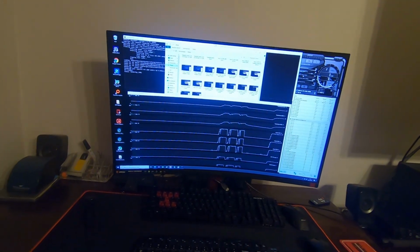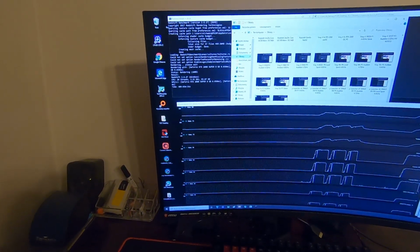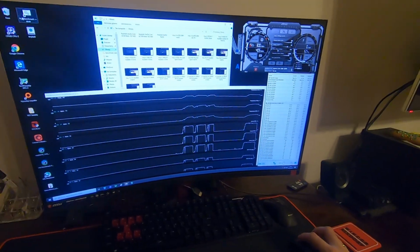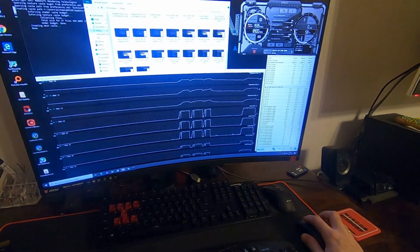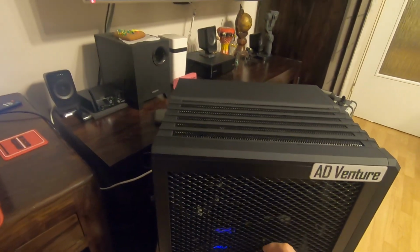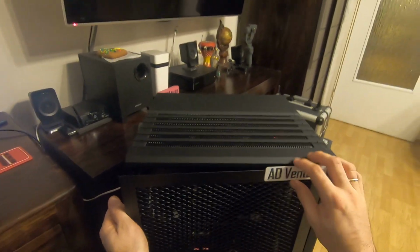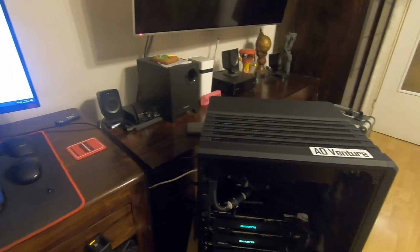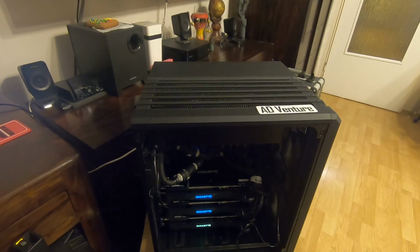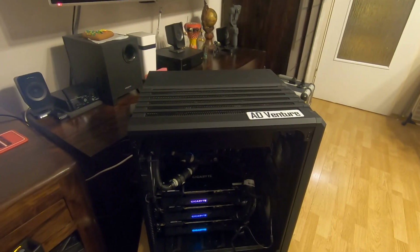Okay, it's finishing. And the score during rendering on CPU is 3 minutes 31 seconds. Okay, we will close this down. Run the GPU benchmark again. As you can hear, the case fans didn't get onto lower RPMs because here is a thermal sensor, which is put behind the first card, and due to that fact, those fans are being controlled by this thermal sensor.